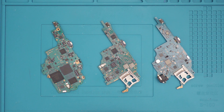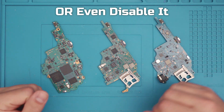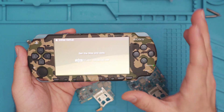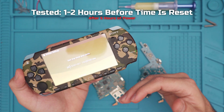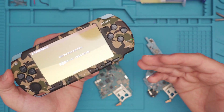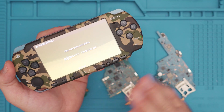Like I said at the start of the video, if you're running into weird power issues — which usually happen on 3000 models — or getting some very weird battery drain even though you have a battery you've tested on a second PSP, you can just simply remove the supercapacitor and that could very well fix things. How you know if your supercapacitor is dead: if you power your PSP through a charger or battery — either on or off — for at least five minutes, then remove the battery and put it back in after about 10 seconds and it's showing you the set time screen, then your supercapacitor is cooked. It should keep time for at least half an hour to an hour. So you can imagine if you have a faulty supercapacitor, it could drain your battery while your PSP is off. Stay tuned for the battery testing video in the future.